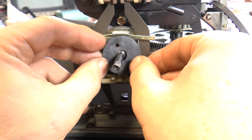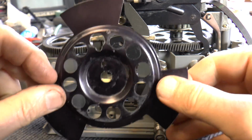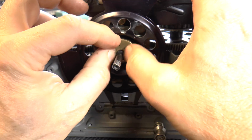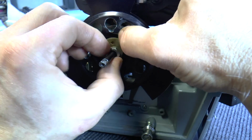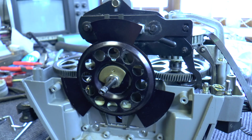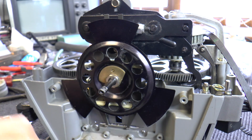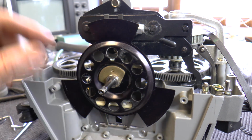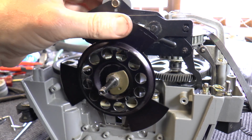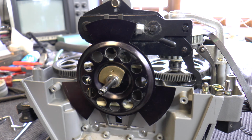The little plastic collar with a hole goes over the phosphor bronze indent at the top. The shutter blade with the hole there corresponds, and the locking collar with the indentation goes over there. And another thing to note is the blade, centre blade, is exactly vertical with the centre pin of the film sprocket drive assembly that's out at the moment. If we turn it round 180 degrees, it goes in, over and out again. Centre frame with the blade at the top.